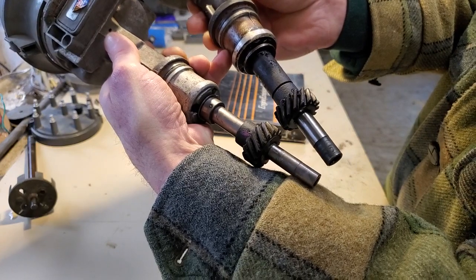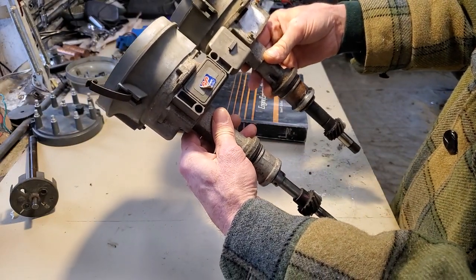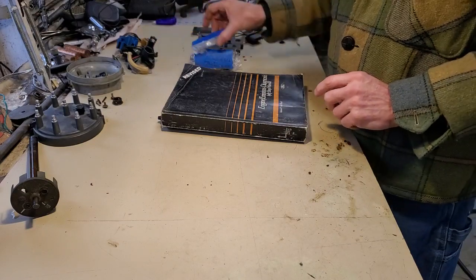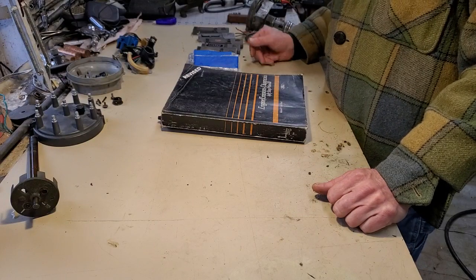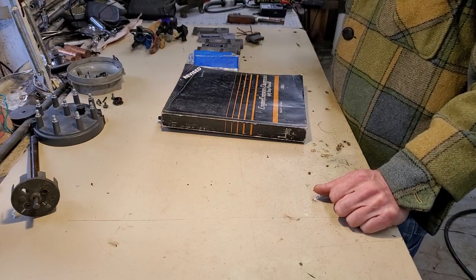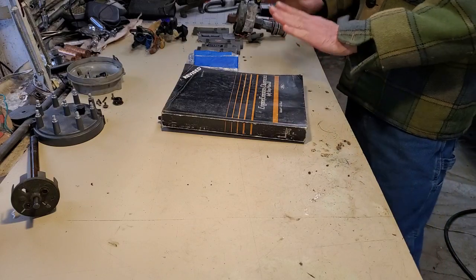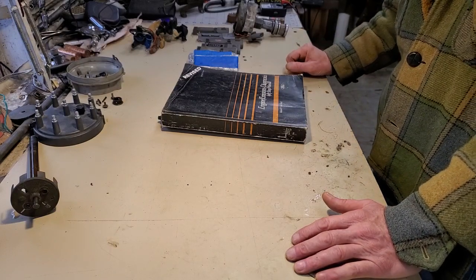The shafts on the end are much thicker — not too much difference in them at all, somewhat interchangeable. My mission here is to verify one through nine ignition modules, and one through eight pickup modules. The way I'm going to be doing that today is by bench testing a distributor, because in the Ford ignition distributor systems you don't need the computer to verify that the system is functional.